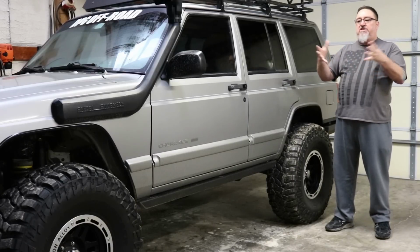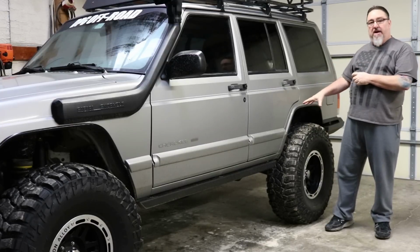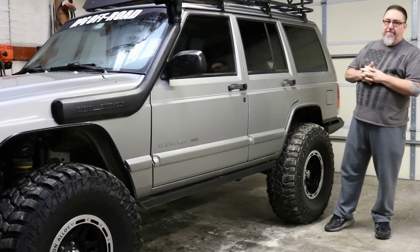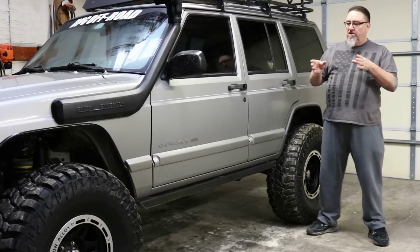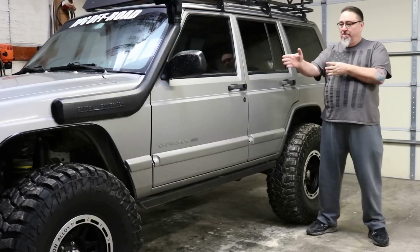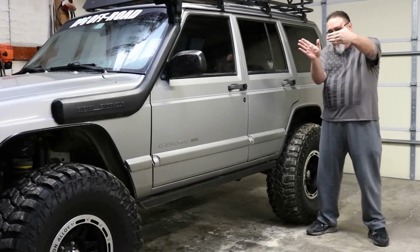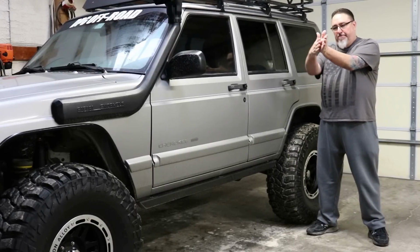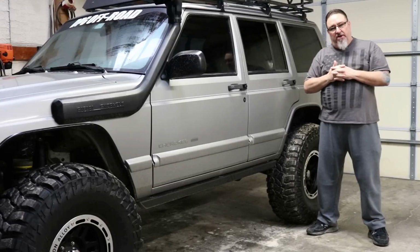The wheel back spacing, the diameter, all of that is different, and you're going to have a different result in how it interacts with that fender well. Some guys I know will run stock wheels and say, well, I'll just get a WJ lower control arm in the front, because even with a 31-inch tire, when you go to steer, the back of that tire being taller is going to reach back deeper and it wants to rub on the lower control arms.